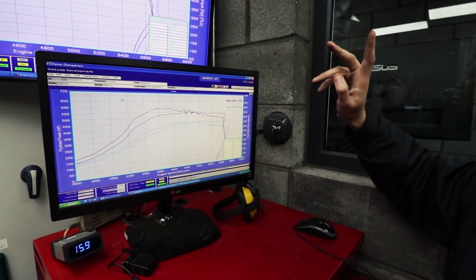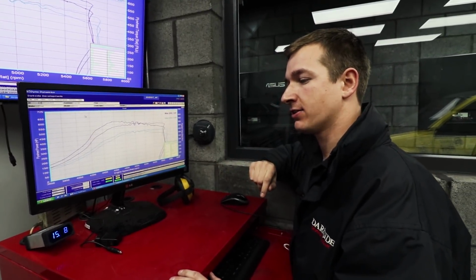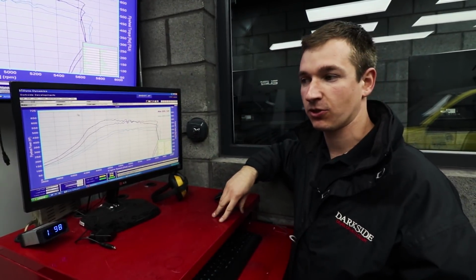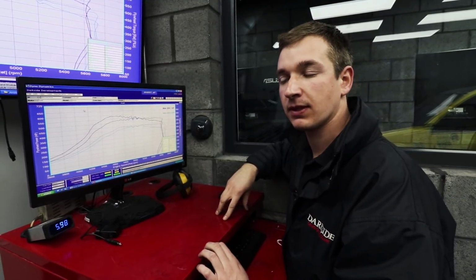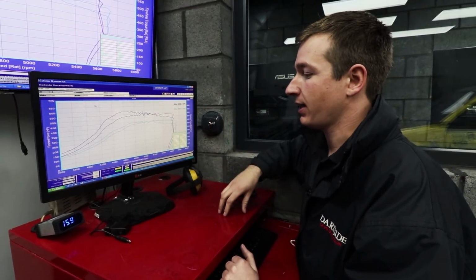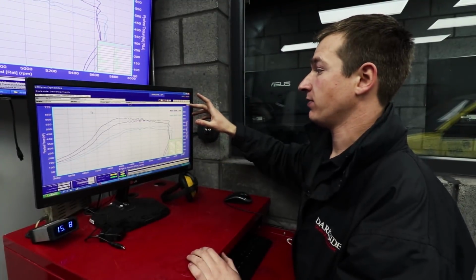And this is 40% of what that nitrous kit will deliver, which is probably nearer to 60% of what it delivered before. Which on the old dyno, we struggled to get traction, but this dyno, the rollers seem to be a little bit more grippy. So we seem to be getting the grip there. If we turned it up to like 80% before or 90%, it just absolutely destroyed tyres. So we're definitely helped by the fact that this car seems a bit happier strapped down on this dyno. We've got 556.